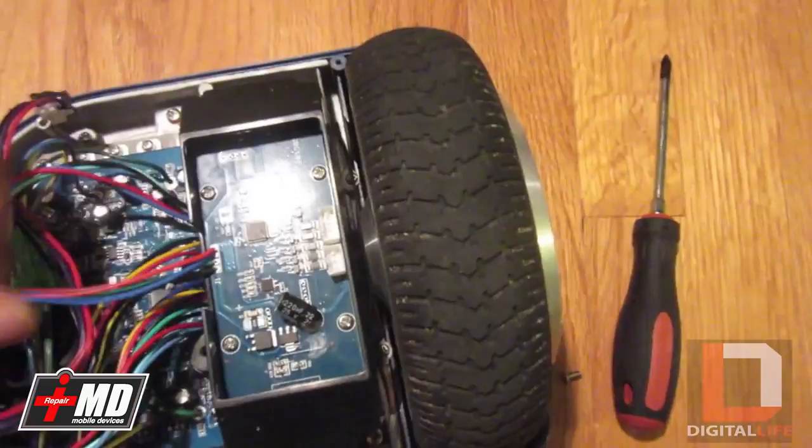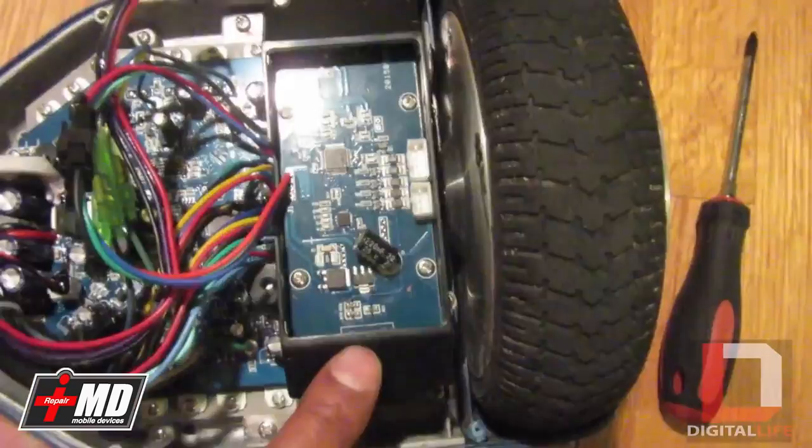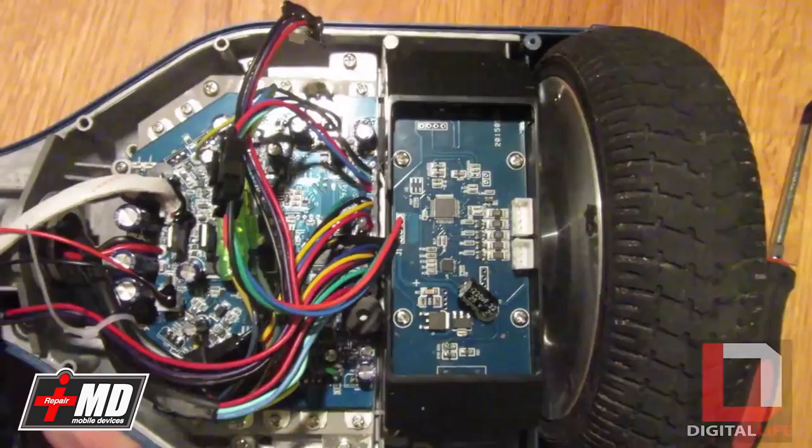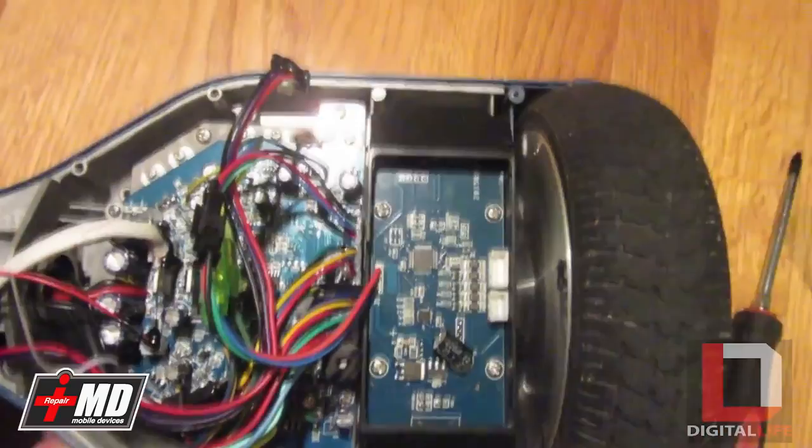This is the two-foot pedal, front and back. The problem is that there's a sensor there — it's not reading the infrared signal. Kind of like a garage door opener where something's in the way, you're going to get that blue obstruction light. So this board is damaged and we need to replace the board. The bulb may be damaged too, but we really can't get a spare bulb, so what we're going to do is just replace the whole board.